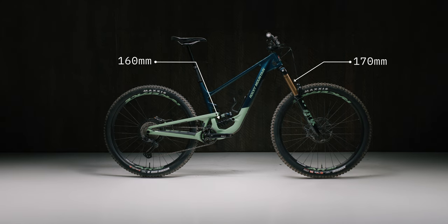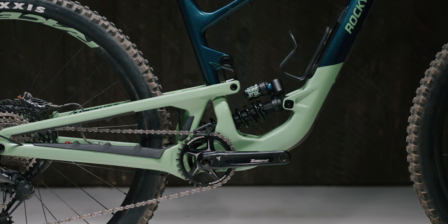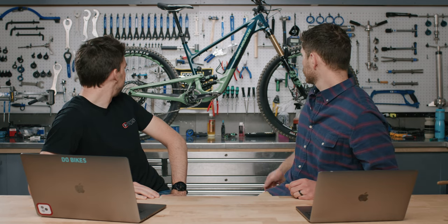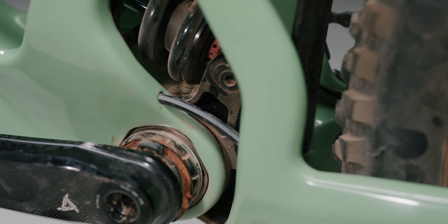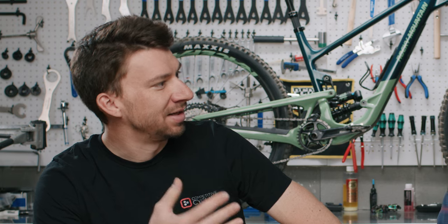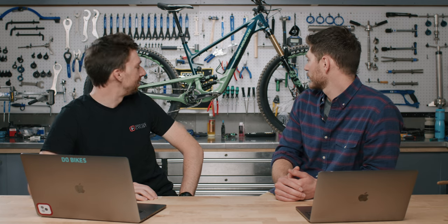So what's changed with the new version? It's 160mm travel in the rear and 170mm in the front fork. The biggest thing right when you look at it is the new rear linkage design. Rocky Mountain is calling it the LC2R, which stands for Low Center Counter Rotating. You can see it better from the non-drive side. The whole link kind of revolves around the bottom bracket — the bottom bracket essentially is a pivot point. You could see the whole linkage under there around the bottom bracket and it's a wild design. It rides different than anything else I've ever ridden.